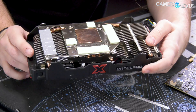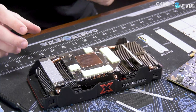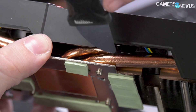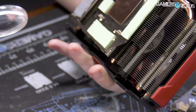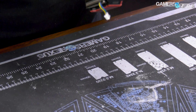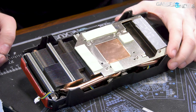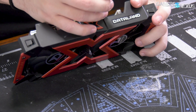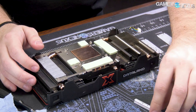There are three heat pipes, and they look to be about two 8mm and one 6mm heat pipe by eye. They soldered the heat pipe to the plate, so even though it's got those screws for retention, we would have to decouple the plate from the fins and the heat pipes. This is reasonably good quality, actually — better than expected. In order to separate it, you'd have to break the bond between the fin stack, the heat pipes, and the plate. So this is actually better assembly than expected, despite those things being a bit of a surprise.